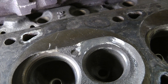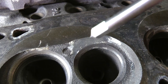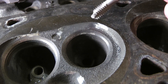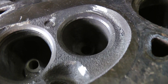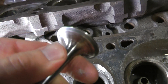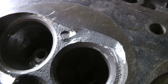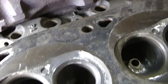The air coming out at this point is leaving at about 500 miles per hour. So by cutting that ramp down, you're giving that much more relief by expanding the actual chamber and allowing that to escape. Especially since this is only a little 1.46-sized valve — it's a relatively small valve. Here's an exhaust valve — see how small that is relative to the chamber or the cylinder on a four-inch cylinder.